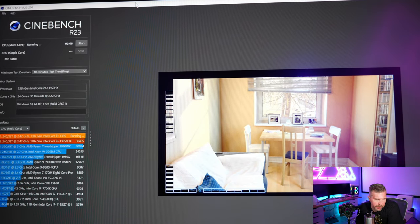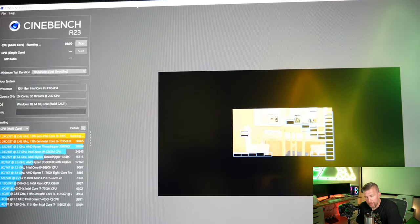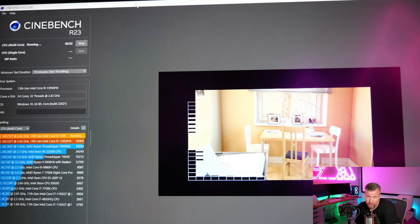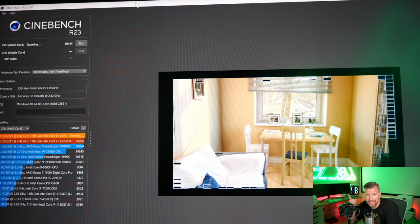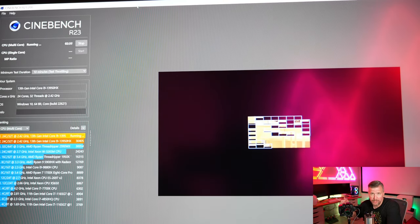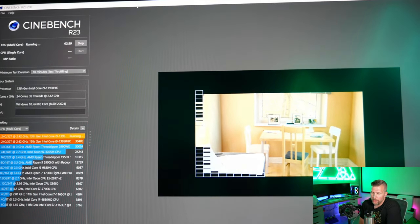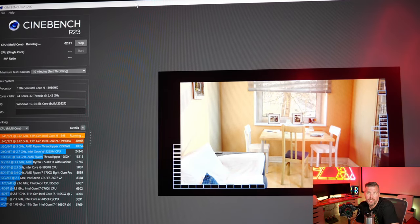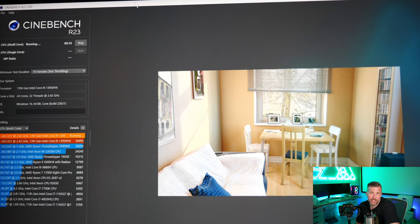Okay, so in theory, will 64 gigs of RAM make gaming faster or possibly give you more FPS? So 64 gigs of RAM typically is not needed for modern games. 32 gigs will pretty much play every game that I know of at maximum possible performance. And really what you want when you're dealing with RAM is fast latency and fast overall speed. Those two things can really boost your overall gaming performance. So you want something that has really quick response and can also process a lot of information as quickly as possible. That's the key if you're looking to upgrade. And going to 64 gigs, it's just harder for them to engineer the faster speeds and latency. So that's why 32 gigs is likely to be faster and better for gaming, especially when you're talking price to performance ratio.